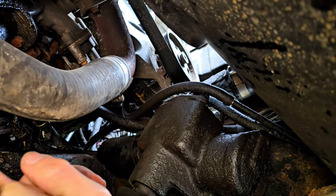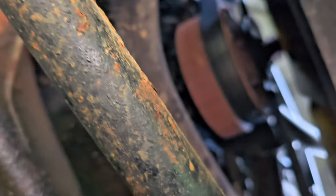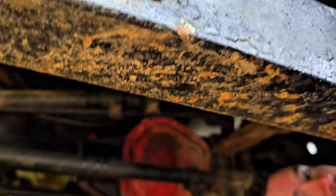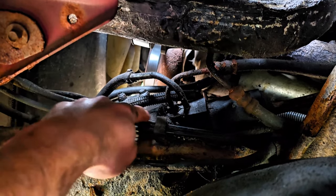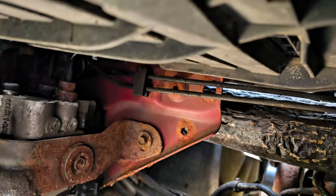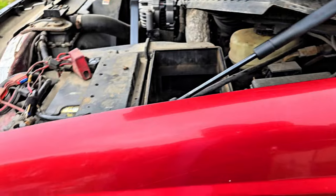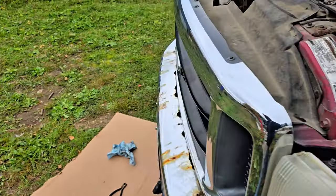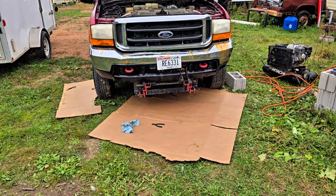I've cut from there to here. We somehow got to get a replacement line — we're trying to disconnect it from that side over there. Let's see if we can just replace the whole line. It's that line right there, which comes up to there, but it's the far back corner one that goes way down under there. So I'm trying to remove the battery box, see if we can get at that distribution block. Then we can just replace the whole line from one side to the other without having to splice it. But if we can't get at it, then we got to splice it.